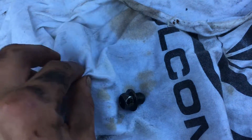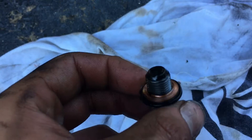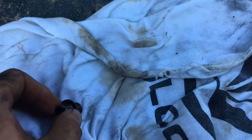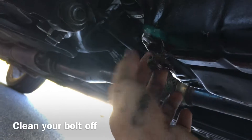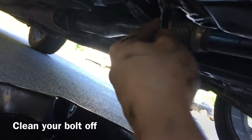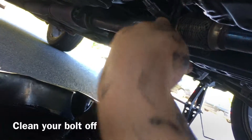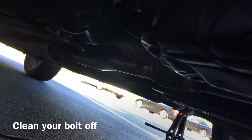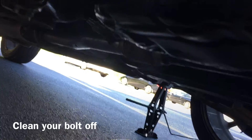I'm going to clean up the drain bolt real quick with this old t-shirt I use for oil changes — just make sure it's nice and shiny with no rocks or debris on it. Check the copper washer, make sure it's not deformed in one area. I do need to replace the bolt at some point. Stick the bolt back in, press it in, drive it flush, then snug it up — you don't want it too tight, but you don't want it to fall out either.